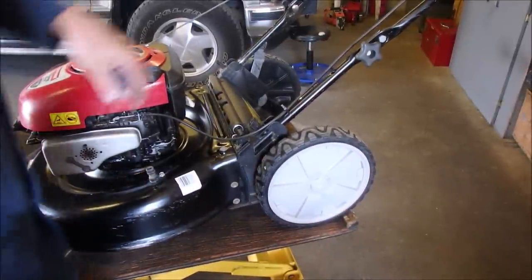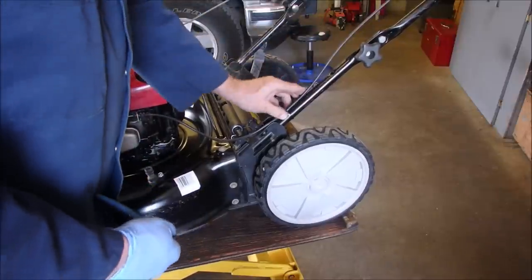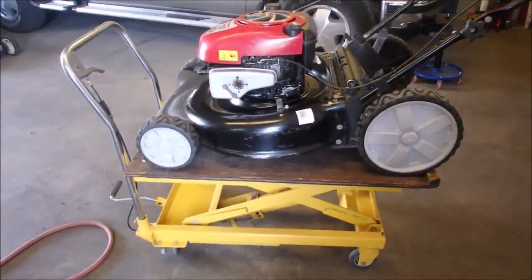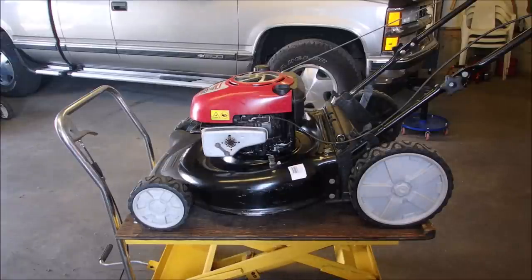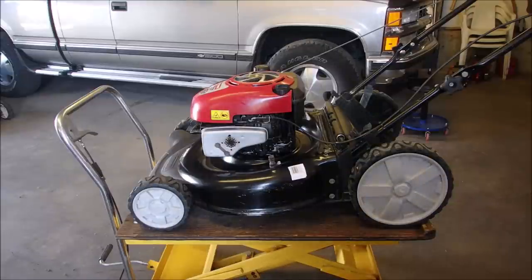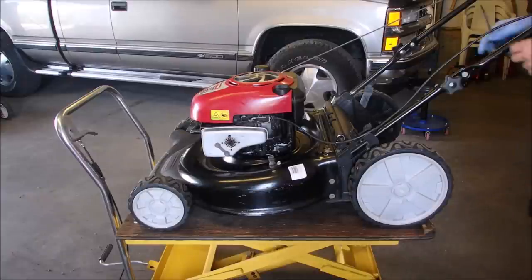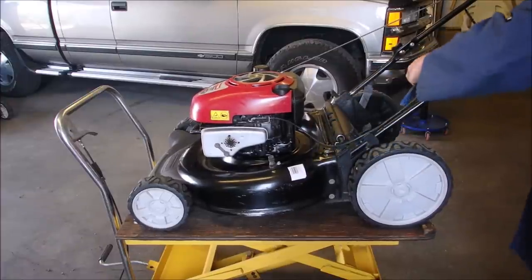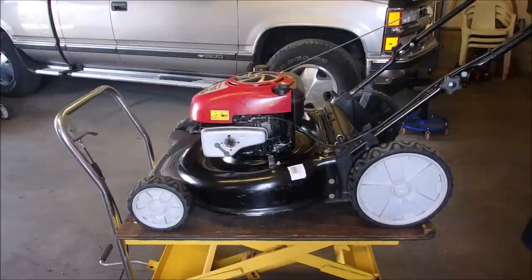So the way it's supposed to be done is a nice sharp pair of snips and flush so you can't get cut, right? And then even turn it in a little bit. Seems like a small thing, but I can tell you I've had hundreds of cuts from those. That's the thing in my trade that I came from. We went from string to attach everything, wax string, tie wraps, and in the early days you had an inspector come by and inspect your work. There we go. You can pull it tight and then cut it off. That's not even a sharp snip as good as I like. There we go.